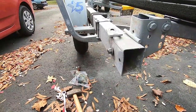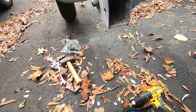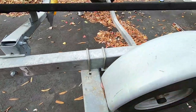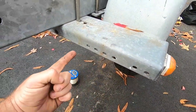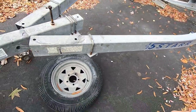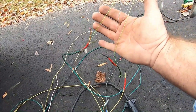I've taken those off, which left me with the wiring. What I did was attach some 60-pound mono line there, and did the same to the other side. The marker lights right here are going to be replaced. The wire went underneath and up to the back through this hole, and I attached some line there coming all the way up to the front. So now it's just mono — those are going to be my pull lines to pull fresh wire down in.